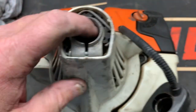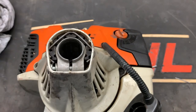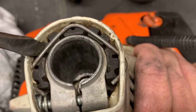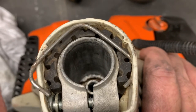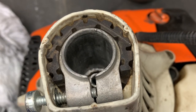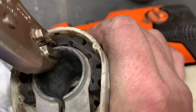Now here's a little bit better view of that bushing that's worn out. You'll reuse the collar or the clamp collar here and you'll reuse the retaining ring, but we're going to replace this rubber in here. We need to just remove the retaining ring. Get a flat blade screwdriver and as you can tell it protrudes through the side over here, so just get close to where it pokes through. Just lift it up, pop it out, and this one should just come right out. Go ahead and finish removing the clamp screw — be careful not to lose the washer.